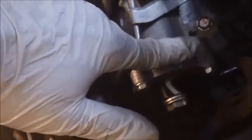The filter is held in right in there, and there's another 10 millimeter bolt, and I don't know if you can see, but sorry about that. Hang on, way buried underneath there. I don't know if you can even see that. Hang on. Right there. Right below that other bolt towards the front, there's a 10 millimeter bolt way hidden down deep in there. So when you remove those three 10 millimeter bolts, this housing should come right out, and that should show us where the filter is.